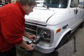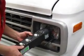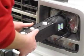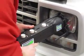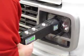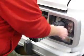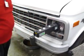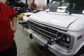I'm going to, again, put my rods onto the 2 pads, tilt it up, pull down on my piston handle, and push forward on the piston handle. Pulling back on the handle without touching the release button in the middle, and as you can see, this is attached to the unit. I'm now ready to check the aim.